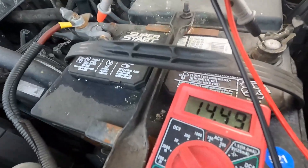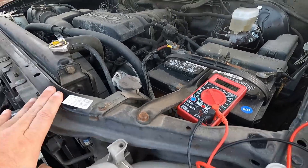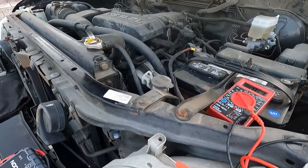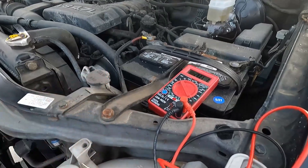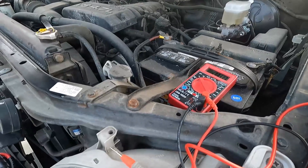You can see our alternator is working really hard right now. The reason I shut this off rather than just let the alternator charge it is that's really forcing the alternator to work harder than it should. A lot of times I've seen alternators almost just burn up — they're just doing way too much current, way too much output.